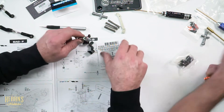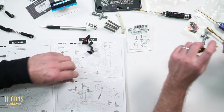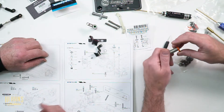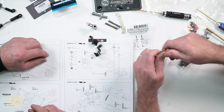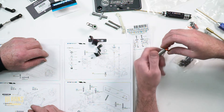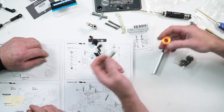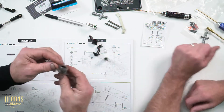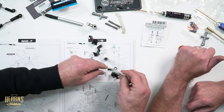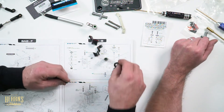The HB one is really good and really robust - or the steering seizes up and then it overcooks your servo. We're going to struggle to overcook the servos mate - there's this banger, it's like a hundred kilo servo. I'm going to put a CB700 in these. I know you do love the Futaba servos. So, can you see what I'm doing here? I'm just double checking the thread before we go any further. It's quite a fine thread on the servo saver. You need to grease that thread so it doesn't gall - it's aluminium on aluminium. You can see that's beautiful engineering, great quality stuff. It's all hard anodised.